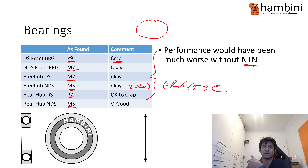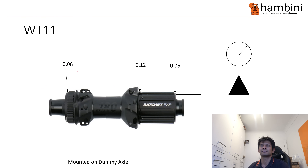This is the runout data for the wheels and you can quite clearly see where the errors or the poor bits are. You want these numbers to be as close to zero as you can get. Up near the hub — I've used DT Swiss's picture here but you get the idea — up near the freehub where it comes up to the spoke flange, you've got like 0.12 millimeters of runout. I think it's because of that excess tension that has distorted the flange, and that's what's giving you that. And then this one on this side is just crap machining or crap manufacturing. They've got a load of circular fits in there and you've ended up with significant runout — it's very difficult to overcome that once you've done it. You really have to true it back to zero.